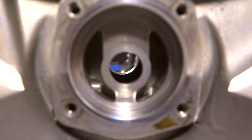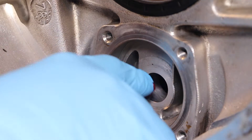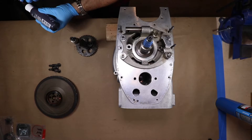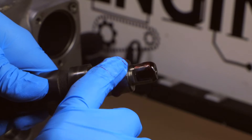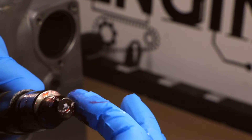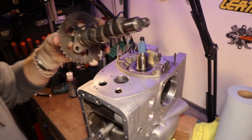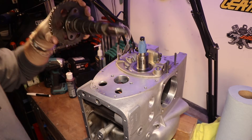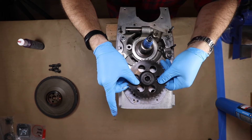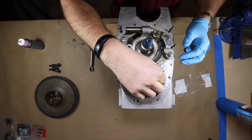Now we're going to be putting the oil pump in place. We can see where the oil pump goes — it connects onto the back of the camshaft. We need to lube the hole where the bottom of the camshaft will poke through when we put it in from the other side. I'm lubing everything with a thick engine assembly lube — this red lube here. This is the camshaft and it sits below the crankshaft. After lubing everything and adding some oil to the places that need it, it's time to turn it upside down and drop it into place. The end of the camshaft will poke through that lubed hole on the other side, and that's where the oil pump connects. There are two screws to hold the camshaft in place — I'm putting those in now and torquing them to spec.